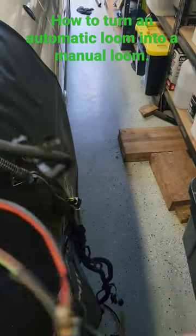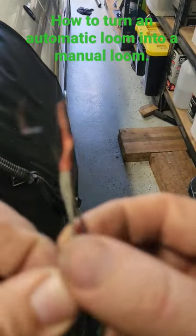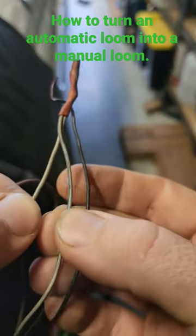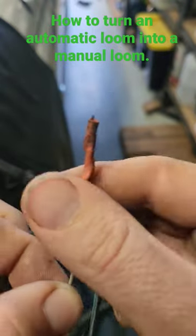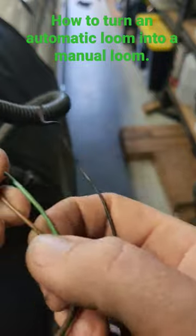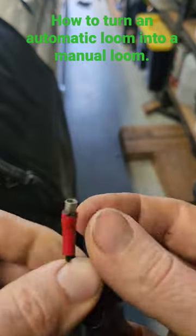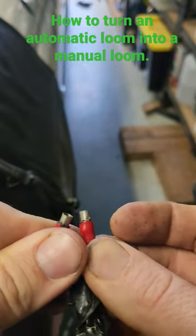What you need to do in your other wiring area is short out the grey with blue stripe and grey, which is your neutral switch — those get shorted out. This here is your reverse, which is brown with blue and green. You just put that on a terminal and run it into your reverse switch.